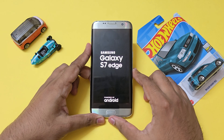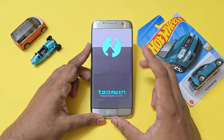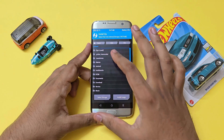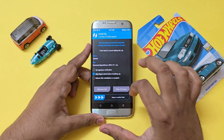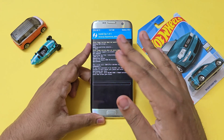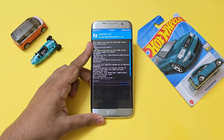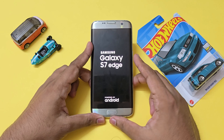This recovery is quite necessary to avoid any failures in installation. Reboot the recovery, and make sure you have backed up all your data because we will be repartitioning the phone to accommodate the larger Android 16 system. It will shrink your internal storage, give more space to the system, and wipe everything. After rebooting, the screen will go black automatically, which means the device has been successfully repartitioned and will reboot itself into TWRP recovery.